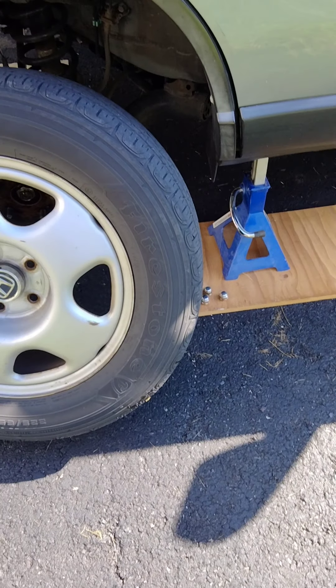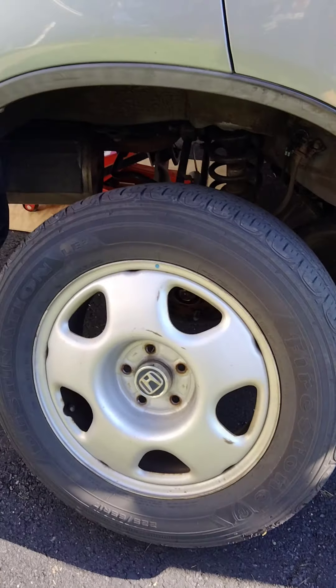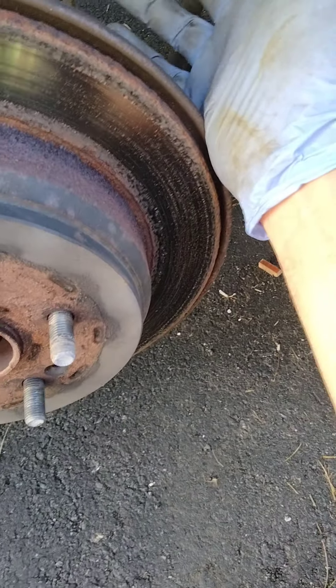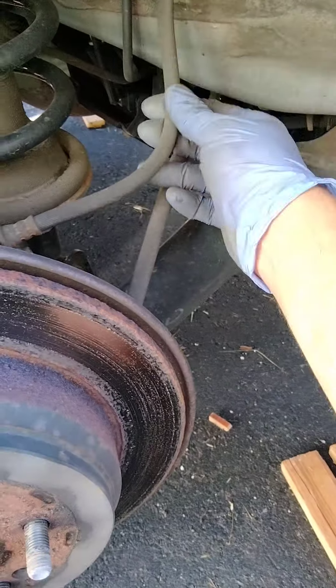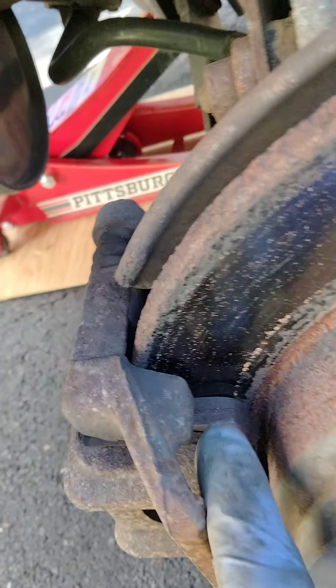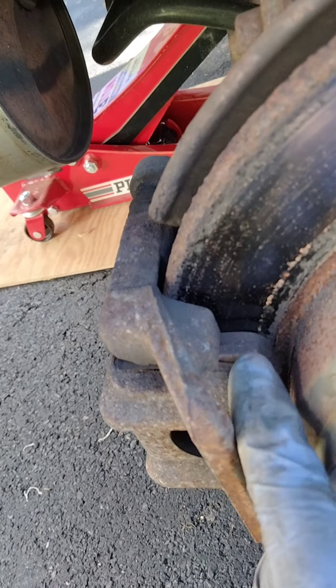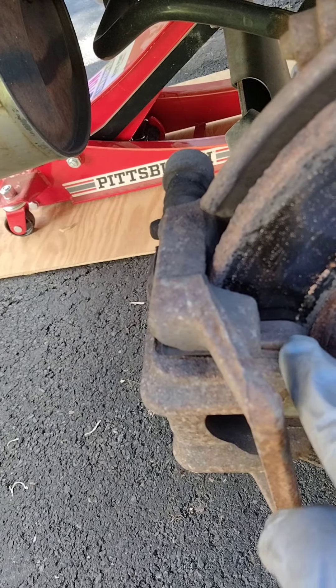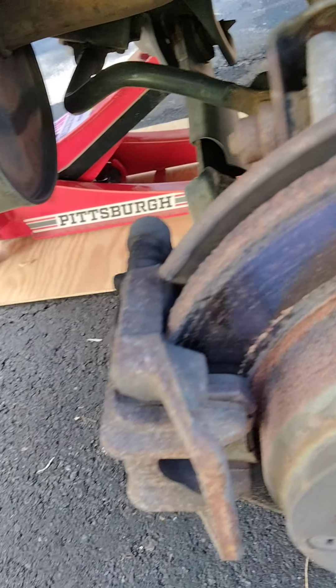So what I'm going to do next is put these wheels back on the vehicle. While you're at this, you can also inspect your brakes and anything else you might want to check. Today is not going to be the day for brakes, but you always want to inspect the brake lines and make sure there's no issues. You can also inspect the brake pads — you can get a gauge for the brake pads, squeeze it in there, and see if that's the right thickness. If it's too thin, you can just replace them.